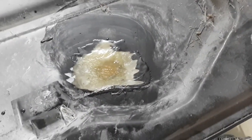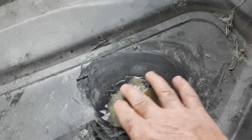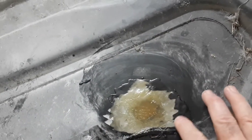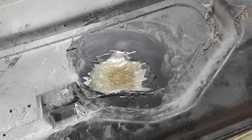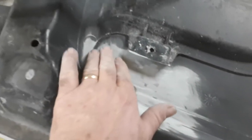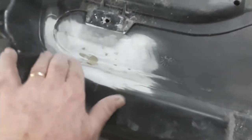I've now patched both inside and out. I bring that down to level — any resin that got on the paint comes right off. I'll take it right down to level so there's none of the resin outside the white area, which is the fiberglass itself. I've sanded everything out with 80 all the way around the repair. There are still a few little grooves here that I'll fill in with body filler and sand smooth.